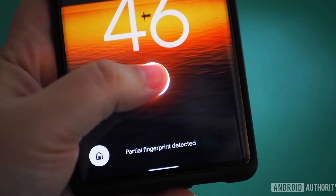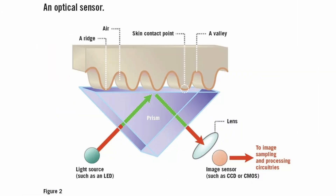One of the types you can find is the optical fingerprint scanner, which is the most common one on smartphones. The way they work is pretty simple — they just take an image of your fingerprint and then take an image again when you go to log into your device and compare the two. They can come in different resolutions like any camera, so the higher the resolution, the more secure the device and the less prone it is to errors. Because they're essentially just comparing images, if the resolution is low enough, they can actually be quite easy to fool with just a high quality picture of someone's thumb. Hence why some companies are now trying to incorporate more sophisticated fingerprint scanners as well.